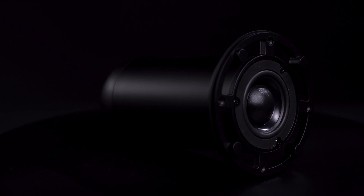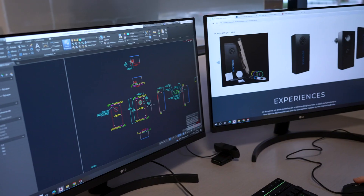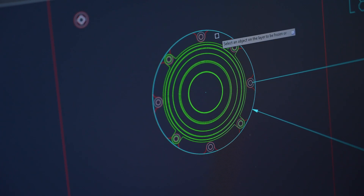The module of a small aperture speaker is another element we wanted to really improve — deconstruct and then reconstruct. The bigger that we make that module, the more we're blocking the port and preventing bass from coming out. Getting that module size down as small as we possibly can is one of the most important things, and that presents its own challenge: the smaller you make a speaker, the harder it is to make it full range.